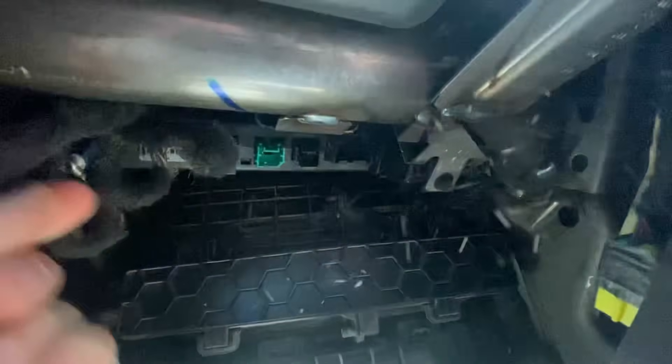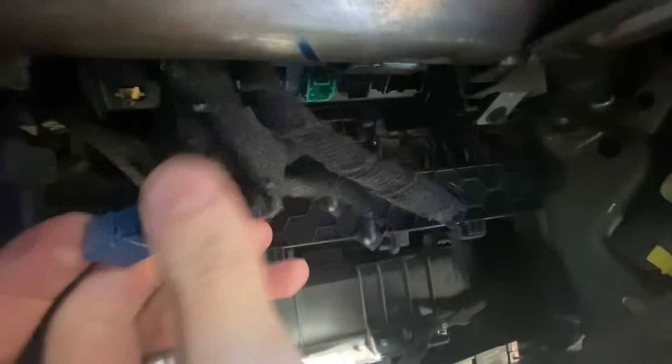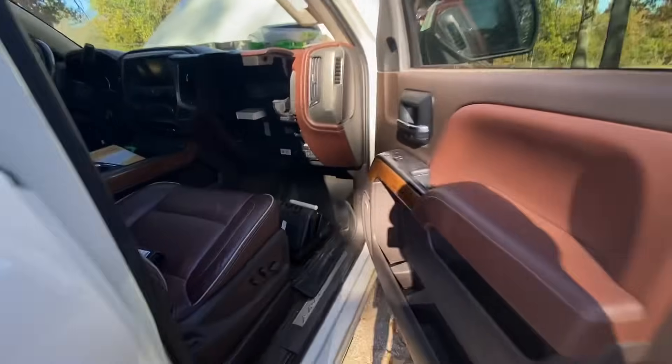You can see there's lots of cables that are tied up, so we're going to need to unplug all of these to slide the HMI out. I know it's kind of hard to see, but just look at your cables and how they clip in there — most of them are probably just little thumb clips that you can grab onto and pull, just like that one. Grab all those and unplug them. They were all just little thumb clips — simply push in on the top on all of these and pull them all out.